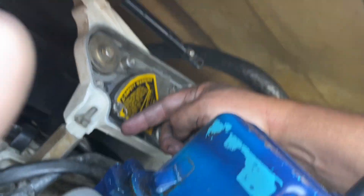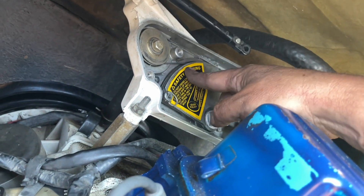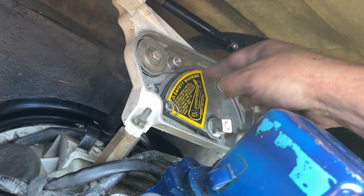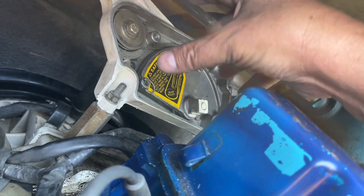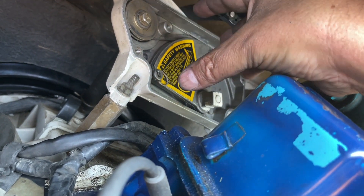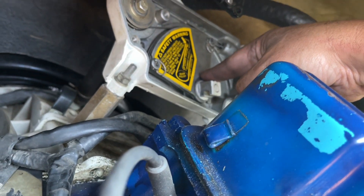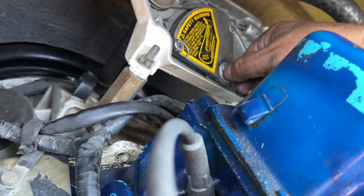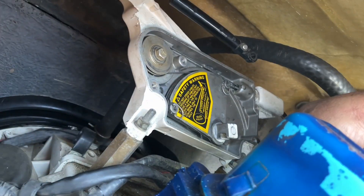When I put the cables on, I have it all the way forward in on the control so it's easier to get the cables on. A little bit of tension - you put it around the idler pulley first. I do the shorter one first, then the idler pulley for the long one. Have the pizza wedge out and then I can add some tension and slide it over the pin that it goes into. This is bolted through; there's a pin on the other side that slides into the female opening.